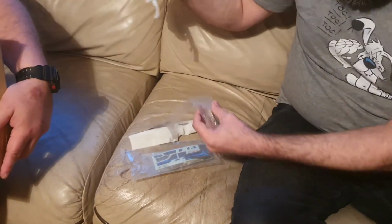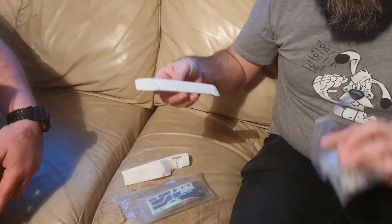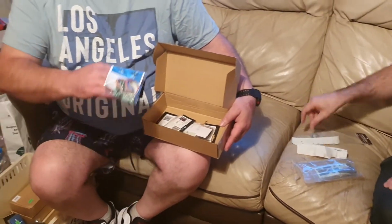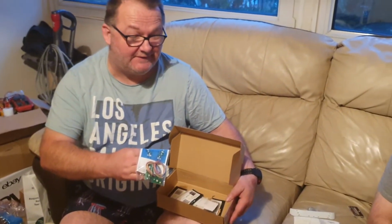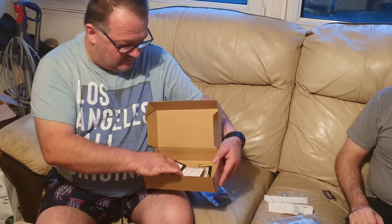And then that is a different roof visor which sits above the windscreen. This one has an absolute ton of LEDs, 9 of them to be exact. Yep, and they provide you with white and yellow ones so you can mix and match. And here we have the front PCBs with ample wiring. I have these similar in my Mercedes and my Scania, and I must say they are an absolute dream to work with. And they're specifically designed to work with the beer systems as well, because the beer system runs a common positive and then all the negatives are switched, so it cuts down on the wiring a lot, because instead of 2 wires per LED you basically have a positive and then however many negatives there are. And there's loads more of them there, look. So that's the front set.